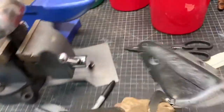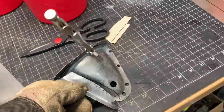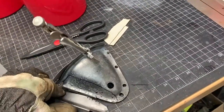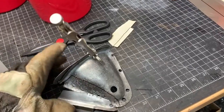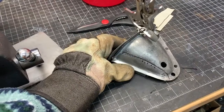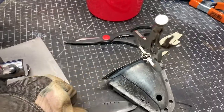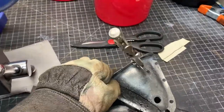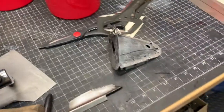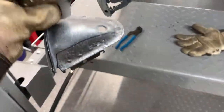I've got a piece here that I've managed to fabricate that will go in here pretty smoothly. I'll just trim that out and weld that in — it'll replace those rust holes. After that it'll be a matter of buttoning this back down, straightening out the flanges, and then that will be ready to go back. Then I will clean out these flanges and get all the rust out of those flanges.